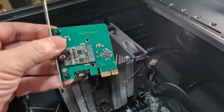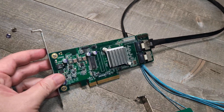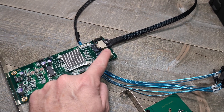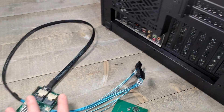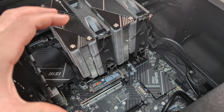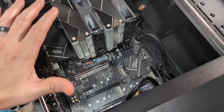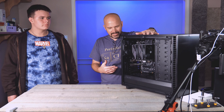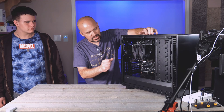There are two more cards we've got to put in here. This is the Google Coral — the dual core. We put that card in, and we also have to add the additional hard drive controller, which has four ports. I do hope I can find the other cable to add another four when I need it. One thing I say before you start adding cards into the system: go boot it up as naked as possible. Even if you're planning on adding a GPU or whatever, boot it up with just the bare bones system. That way if anything goes wrong, you don't have to wonder if it's your cards or something else. Keep it simple, then start adding stuff. Right now I don't even have any hard drives in it — we got everything built with no magic smoke.